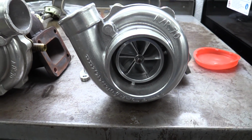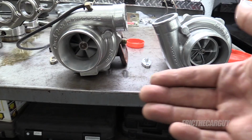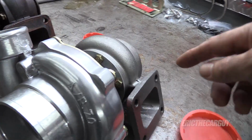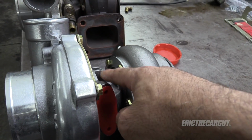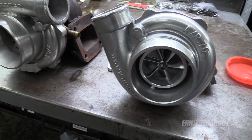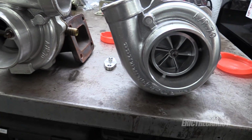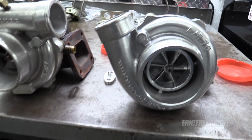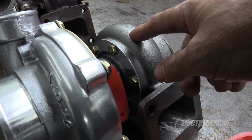So why lose the 3mm? Why go from 70mm down to 67mm? Well, that was the size, number one, but more than anything else, instead of a metal sleeve between here, there are ceramic ball bearings. First of all, ball bearings are going to hold up better, but ceramic ball bearings in particular, ceramic is an insulator, and guess what? This guy makes a ton of heat.